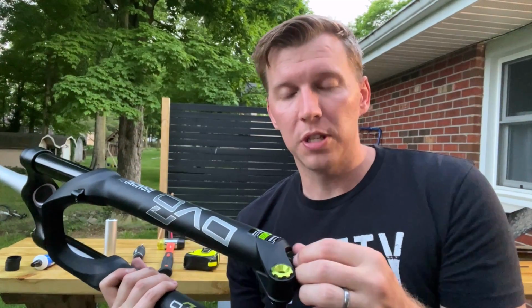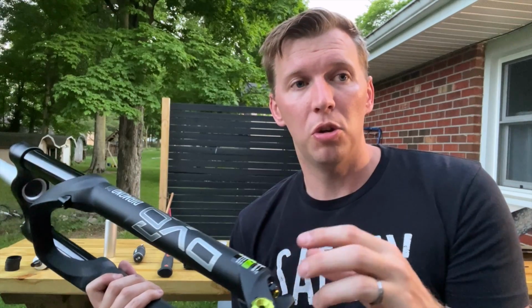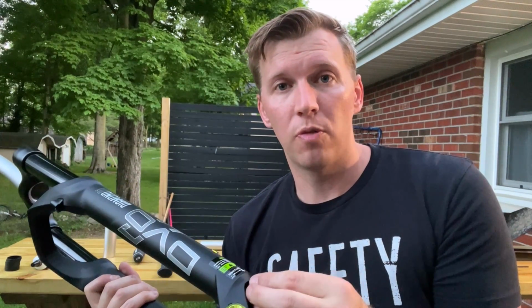And then you're off the top, you can increase the sensitivity for your braking bump sensitivity, your smaller bumps, the initial stroke. I think it goes up to 50 millimeters of travel is how the OTT makes adjustments. So you can have it very much like a magic carpet type feeling when you're over rock gardens or braking bumps, where it just absorbs those. They're really sensitive over those things, but you can still have the support later in your travel through your air pressure.